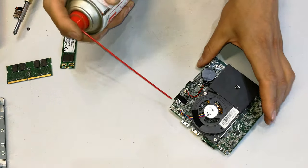Now I'm going to reassemble it. Line up the RF cables and press them in with your nail, turning them slightly. There's a space here for them — make sure you don't gouge the wire on the side. Feed the cable through carefully. Make sure the RF cable does not block the SD card slot. Seat everything nicely — SD card slot is clear, RF cables are fine — then put the screws back in. Note the recess and the lip when seating the board.